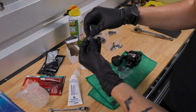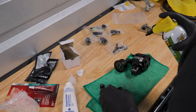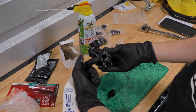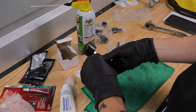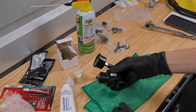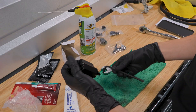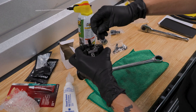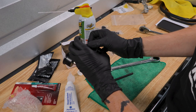These plugs are so small — this is exactly what we're going to be utilizing in those front ports. We're going to go ahead and plug this port and the bottom port. We have high pressure coming into the car, into the rails, and then low pressure leaving back to the pump. We're going to need a socket or Allen key — I believe those are going to be four or five millimeters. We'll need a three-fourths inch wrench for the hose barb fitting, and a quarter inch Allen key for the bungs to plug them up. Those are all sealed — I'll just give it one last ugga-dugga. I feel pretty confident those are not going to be leaking.